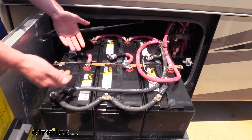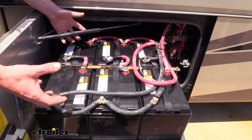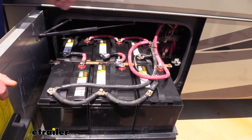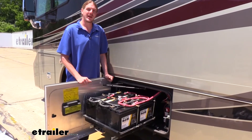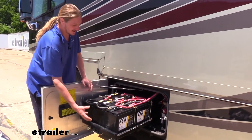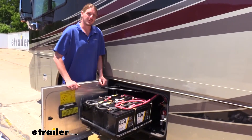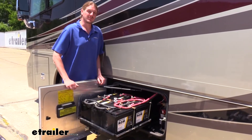The downside is that we do have to have two 6-volt batteries wired in series to get that 12 volts, but if you're looking for higher capacity, this is definitely going to provide more than any of the 12-volt competitors will. This is going to be a quick and simple upgrade from your regular flooded lead acid batteries that's going to help increase your capacity and also give you a nicer, cleaner area because they're not going to be vented and they should last longer without leaking and causing corrosion. Now why don't you follow along with me and we'll show you how we got them installed.